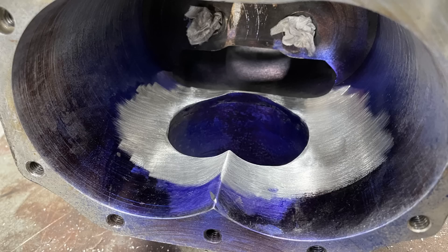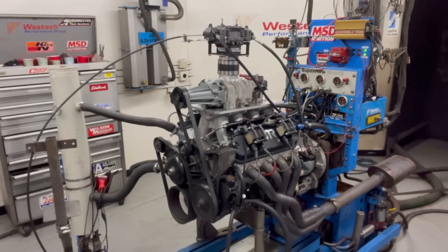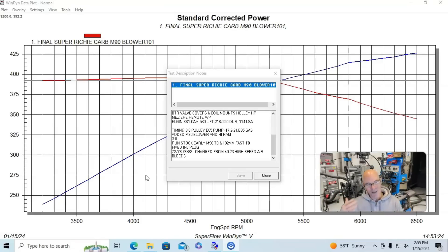I had to do a lot of grinding using a porting tool just like you'd use on cylinder heads — cartridge rolls and carbide bits designed specifically for aluminum. I had to take off a lot of material. We cut a four-inch hole in the top of the blower, and after all the porting the clearances were nowhere near even all the way across. Anybody who knows blowers would have said there's no way that's going to work — but the blower spins, makes boost, and does everything it's supposed to do.